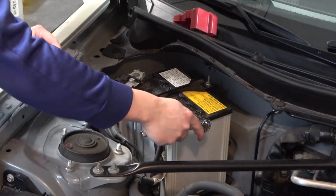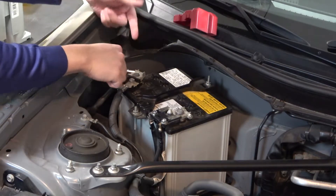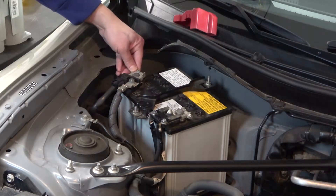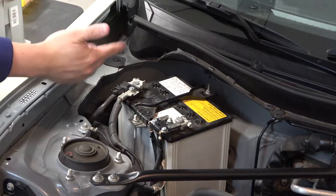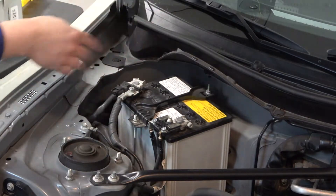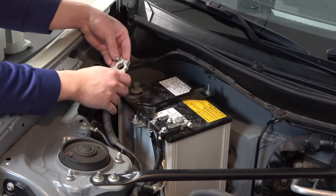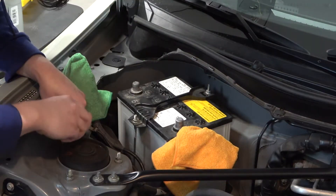Once you're ready, carefully loosen the bolts holding the connectors down. Take care not to accidentally bridge the gap between any metal terminals or metal surfaces with your metal tools — don't risk a dangerous shock, even with a weak battery. Always disconnect negative first. A good memory trick: negative has one line, positive has two lines, and one comes before two. However, when reconnecting your new battery, this is reversed — positive first. Another memory trick: new battery, new things, happy life, positive. Cheesy, but it works. Once the connecting wires are removed, place them aside, pinned down and wrapped in a dry cloth, so no other connections are made and the area is clear.